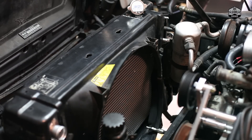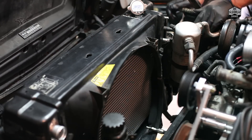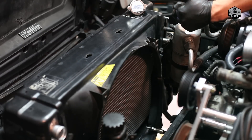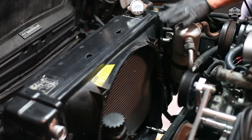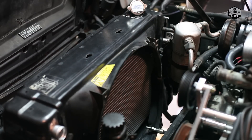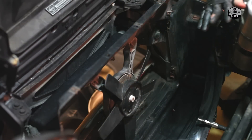I want to make sure everything is lining up flush and I've got enough space, but I am going to have to do some modifications. I'm going to pull this hood back out, get my grinder, and cut out a little bit more of this piece to give enough clearance. I can't go any further up because the housing and brackets would be compromised. So let's go ahead and do that and when we come back we'll finish putting these pieces together.